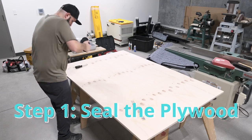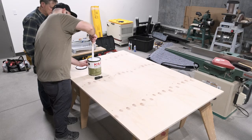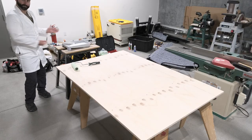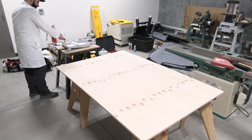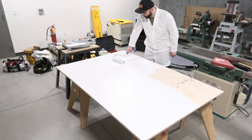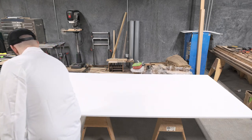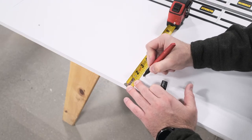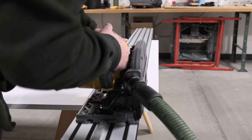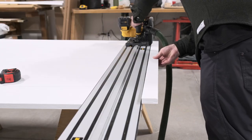After completing your prerequisite truffle shuffle, we're now applying a mold-resistant primer to the wood, just to help water seal. Also, definitely steal your dad's evil scientist lab coat when you're painting because it makes painting way more fun. Just kidding, painting still sucks, but we want to lay down a really thick coat. I knew I wasn't going to come back and do a second coat, so I'm laying it on super thick, then when it dries flipping it over and doing both sides, especially paying attention to seal the edges. If you can, try to do painting last — if you end up coming back and cutting something you're going to have to reseal that seam.